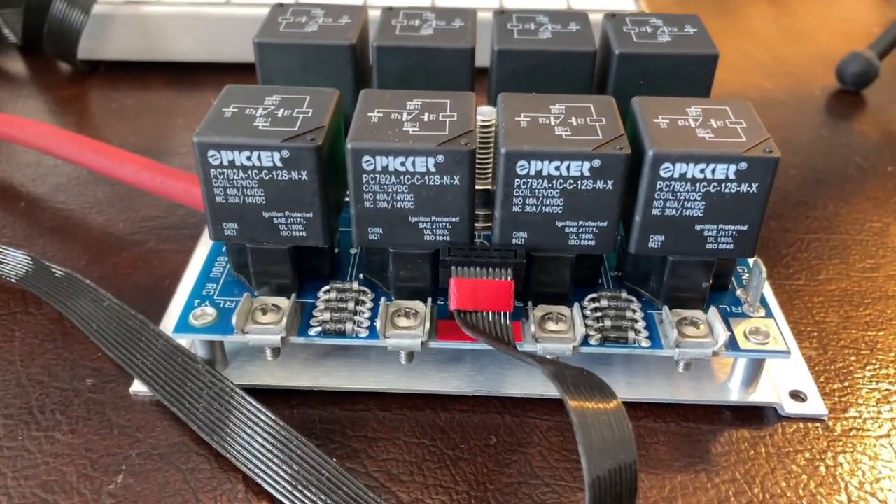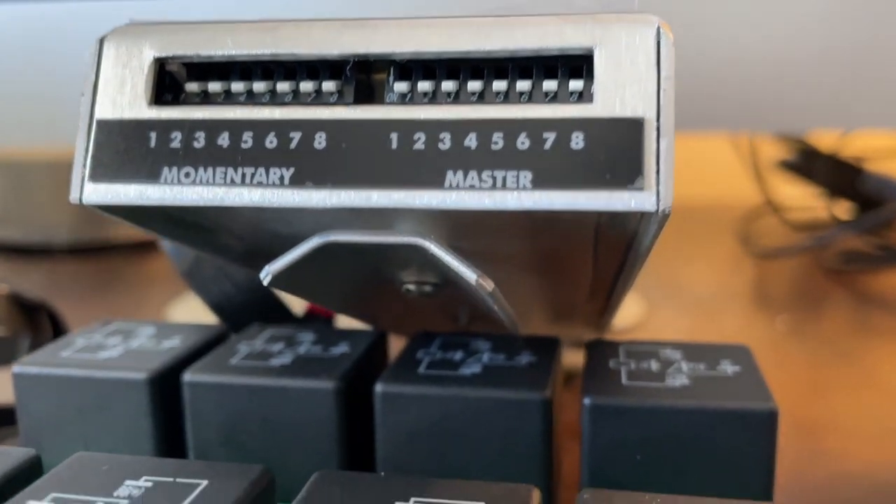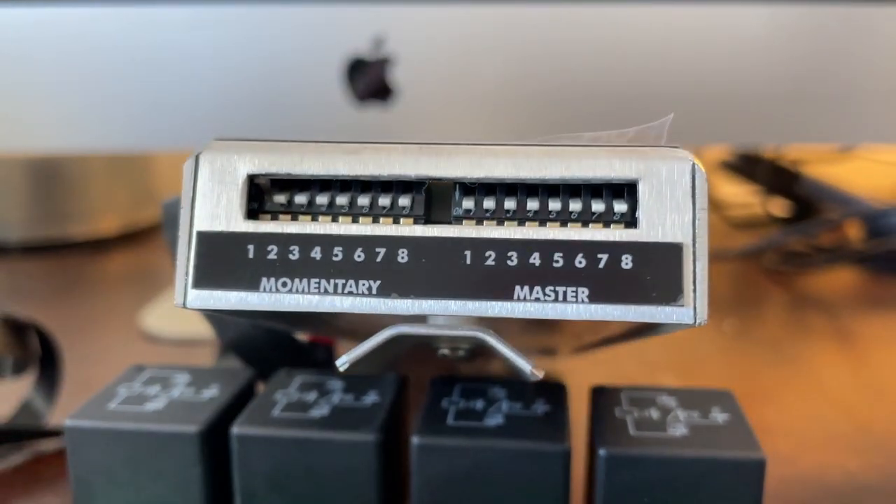Here on the edge of the switch panel you have a momentary switch and a master switch. The momentary switch number 1 is pushed up — it's the starter and will be used to start the car, then release. The other 7 switches are on-off. The master switch on the right is pretty cool: if any switch is pushed up to the off position when you turn off the ignition — which is set as number 2 — any switch that is pushed up will also turn off with the ignition. So if you have a device you want to shut off with the ignition, you flip that dip switch up.